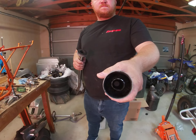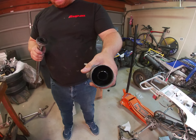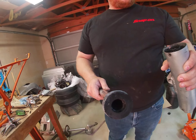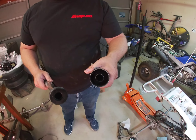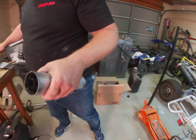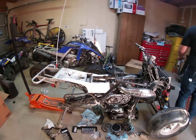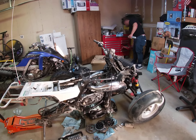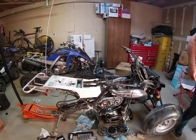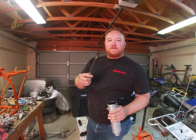As you can see, that is some very garbage work. You can see what it did to the inside right there — this thing was probably running very rich on oil. Ran great, but a lot of carbon buildup there. You can just grab a pick and get that out of there. You gotta have a set of these, especially the long ones — I call them booger pickers, but it's just a pick.